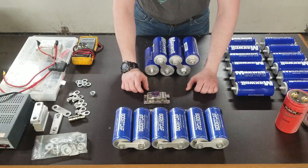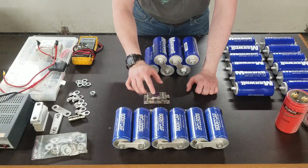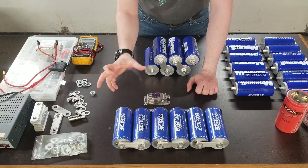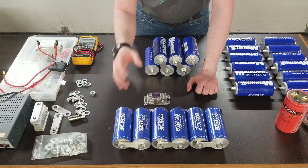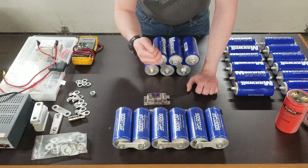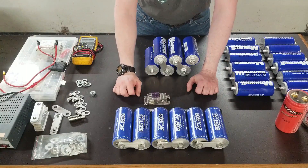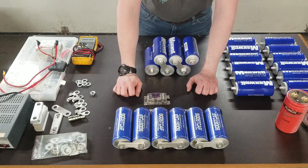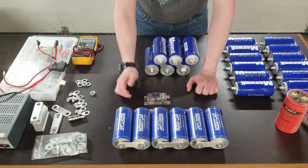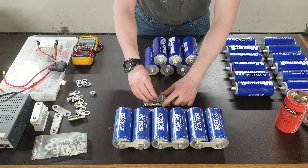A single 100 amp maxi fuse has been fine for two reasons: fuses let a lot of current through for a very short amount of time, and this current usage is fast. We're really just supplementing voltage dips that happen when the amplifier wants a dramatic increase in current — at a crescendo, bass hit, or cymbal crash. That energy has to come from an alternator, which reacts slowly. By the time it responds, the dynamic hit is gone. Batteries are also fairly slow; capacitors located near the amplifier help stabilize that.